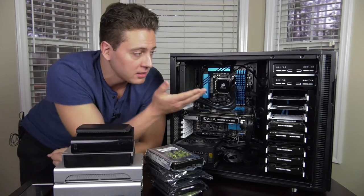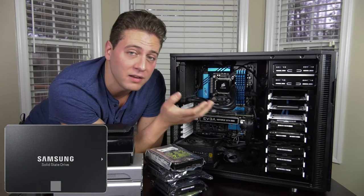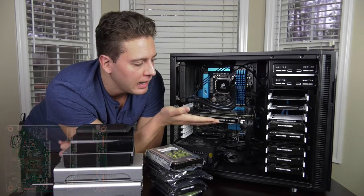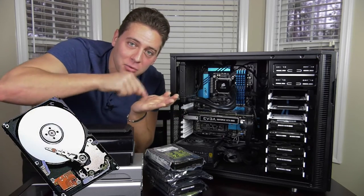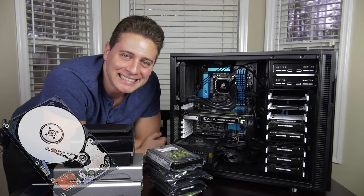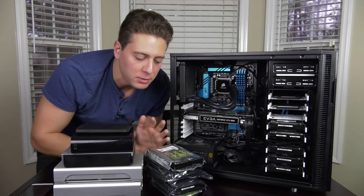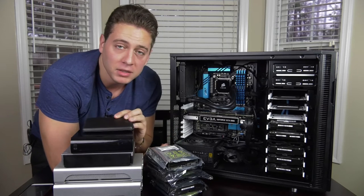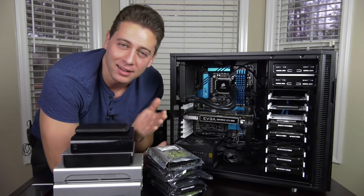There are two types of storage drives. You have solid state drives which are very quick — they read and write very fast, but they're more expensive per megabyte and gigabyte. Then you have hard drives and mechanical drives — there's actually something spinning on them with a little reader needle constantly reading. These are 7200 RPM drives, but there were also 5400 RPM drives for laptops before solid-state really took off.